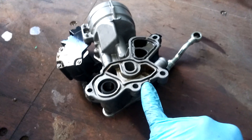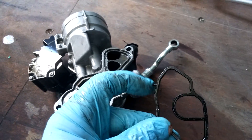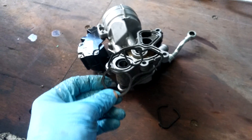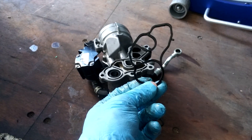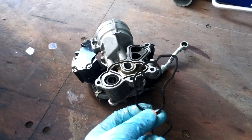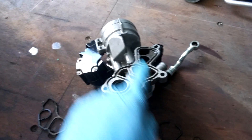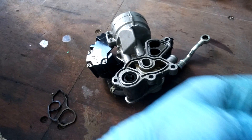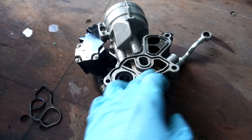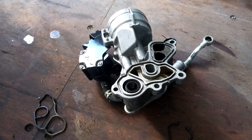As for how they sit in here, there are nice little holes on the top right here and right here, and those correspond to a little nib on the gasket. This is pretty much one of the only times I've ever seen this — most motors don't have any kind of keyways. Maybe it's an early warning system so that oil or antifreeze will start leaking out of those holes when the gaskets fail. But in my mind it's one of the stupidest things I've ever seen, because it's just giving a weep hole for this stuff to escape. Even if the gasket starts to fail somewhere nowhere near that weep hole, the fluid will find its way all the way around and start coming out. Most gaskets are completely sealed all the way around — if fluid gets into the channel, it stays there. Very dumb design.